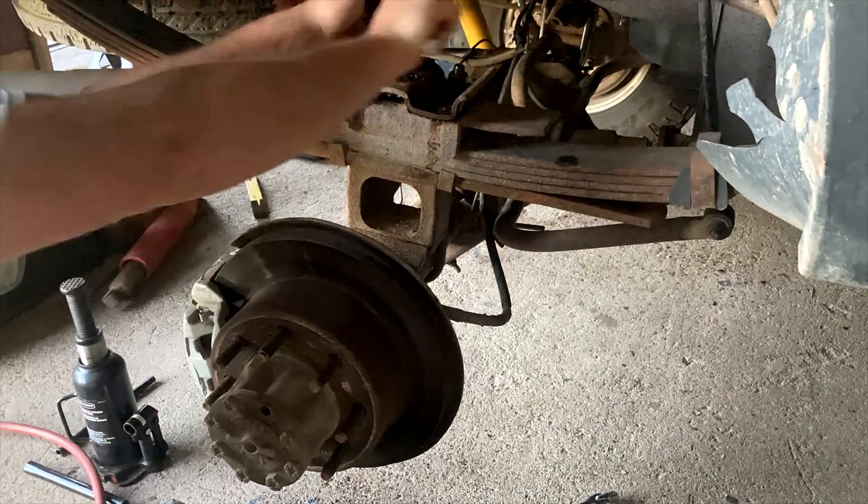We got about 30 kilometers on with the Hellwig installed and I'm sold - there's like zero body roll. We've established a good ride height and I feel like I have steering back with this big camper. In fact it doesn't even feel like we're hauling the camper right now. At some point during our journey we'll double check all the torque on the bolts to make sure nothing comes loose - that should be the maintenance you have to do on these Hellwig helper springs.